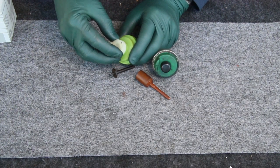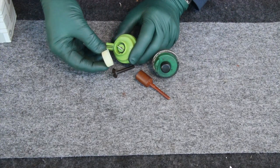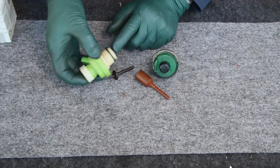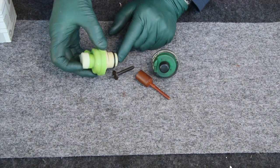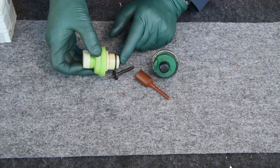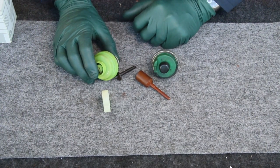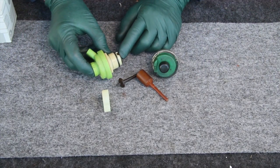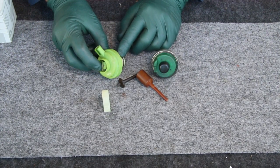It keeps it from moving. But if it's put on properly, you can do fine adjustments without removing the cap. So that's a real plus. I'm really excited about this. They also changed the innards. It has a more responsive vacuum response. And I think all in all, you'll find if you're having what I would consider minor problems with shift in your transmission, the upgraded modulator may help.